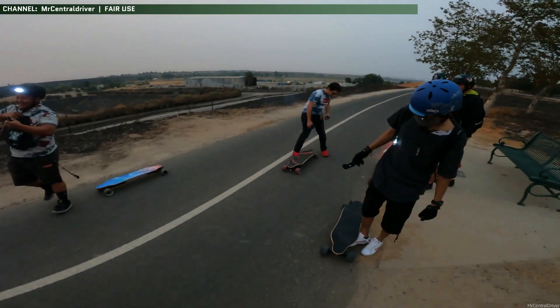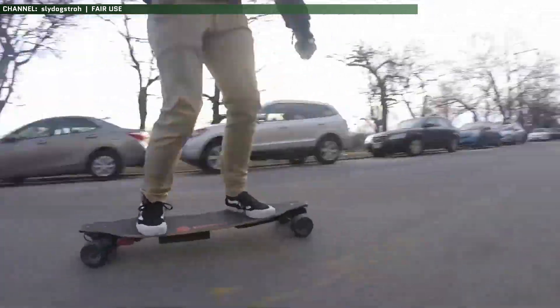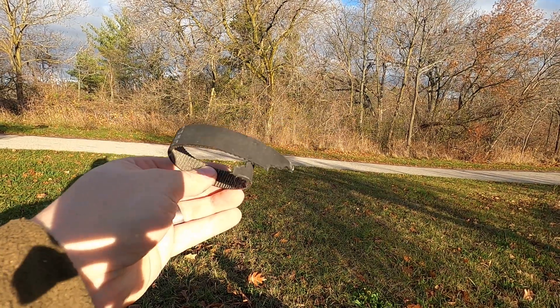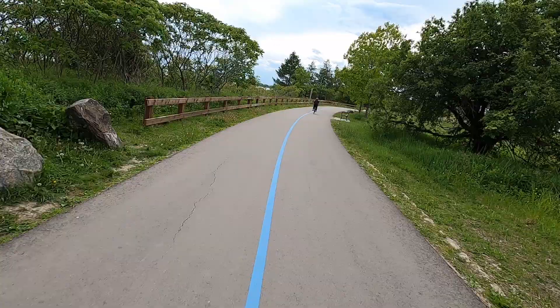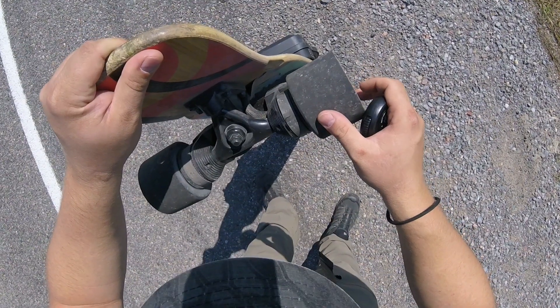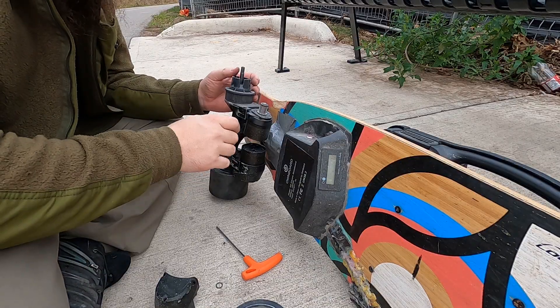When you're doing a long distance ride like a group ride, or my specific use case of skatepacking, or even if you're just doing longer commutes on your board, reliability matters. You don't want to be mid-ride when a belt snaps or starts skipping, especially if you're with a group or you're going to be running late. Your mileage may vary — those with nice clean asphalt may not have these issues — but I find that not only do my belts have a lot shorter lifespan than you'd hope, but my wheel pulleys also get grinded up rather quickly.